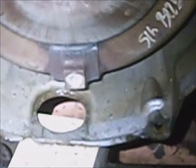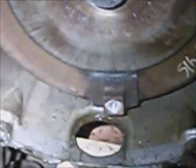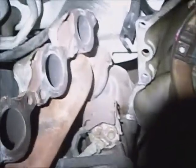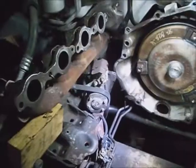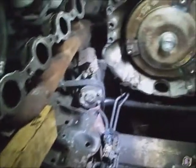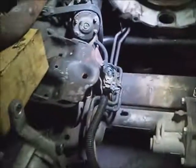Looks like that lower ear is about middle ways of that inspection hole down there. I'm going to wipe some of that sand debris out of the bell housing from grinding the rust and scale off the manifold. I took an air hose and blew all the sand and metal particles out of the manifold ports and the bell housing, and cleaned up a spot for the engine mounts to lay on so they're not sitting on a bunch of grime.